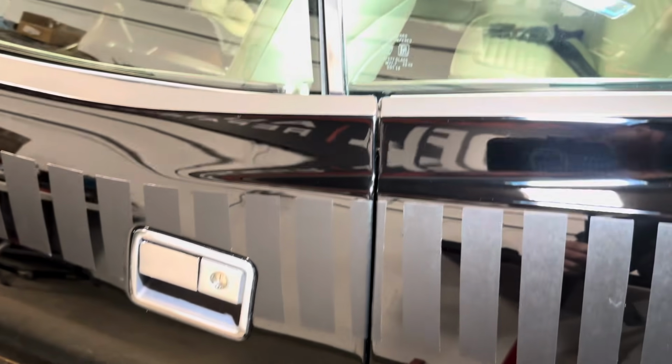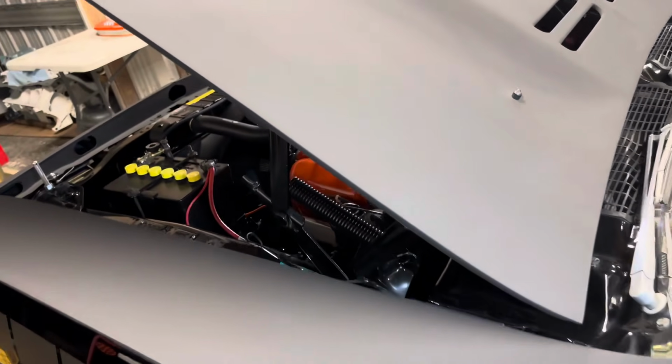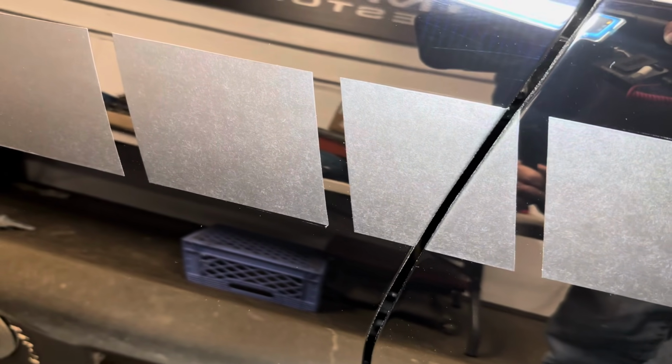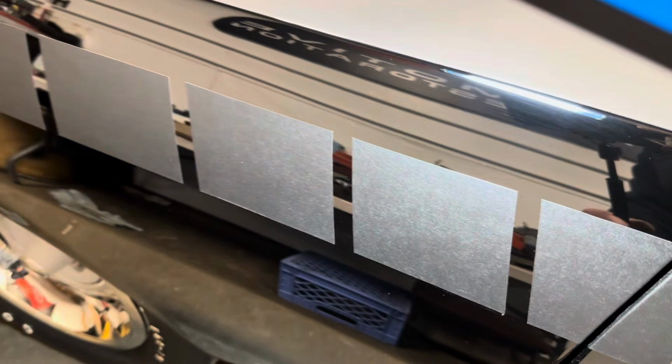Get up close and take a look at that. The organosol finish on that is something that we sprayed on there. Now there's a lot of different formulas for organosol. This was an old formula provided by Frank Battleson, and we sprayed it on. Pretty nice. It went really well. So it's got a little bit of texture to it, but it's still smooth enough that you can wipe it down. And it also looks the same as the original stripe. Reproduction stripes do not have this texture. They're just kind of a flat vinyl look.